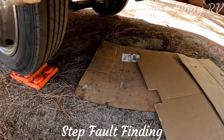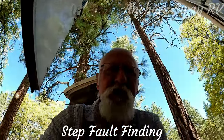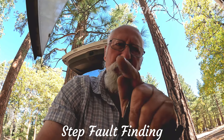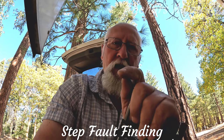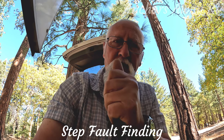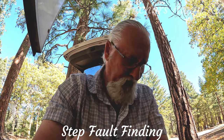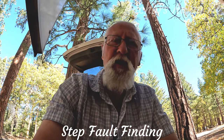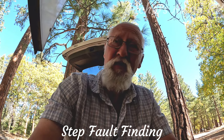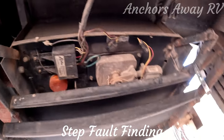I've put cardboard under here for me to lie on because the stairs are up here. One thing I really want to stress: the stairs are a mechanical device, and if it operates while you've got your arm, head, or fingers in there, it will crush them. So number one, don't work on it with any power on — one slip, one miscalculation, and you could lose a finger or something catastrophic. Also make sure your bus isn't going to roll over you. Position yourself so that if something happens, you won't get crushed.